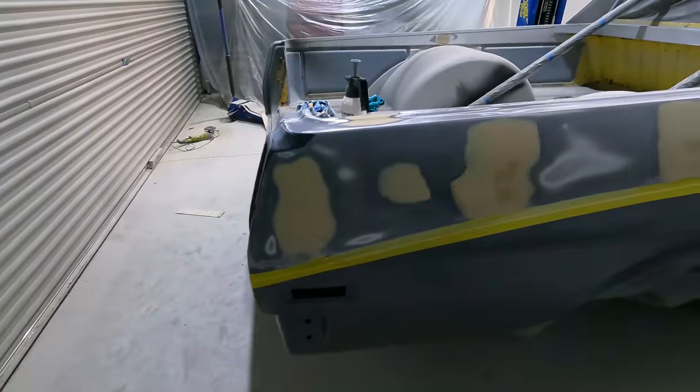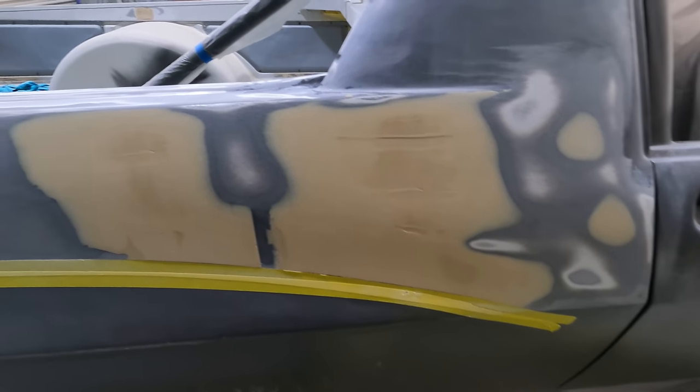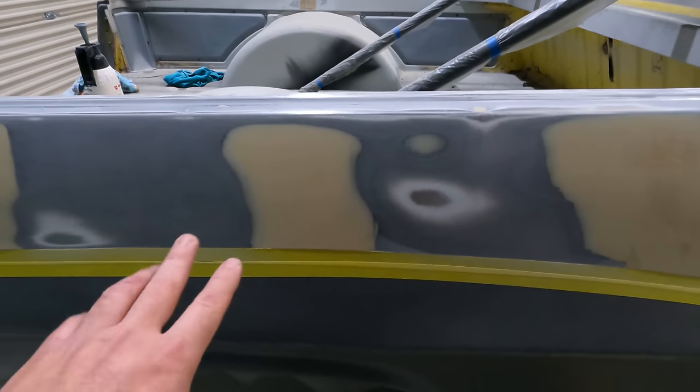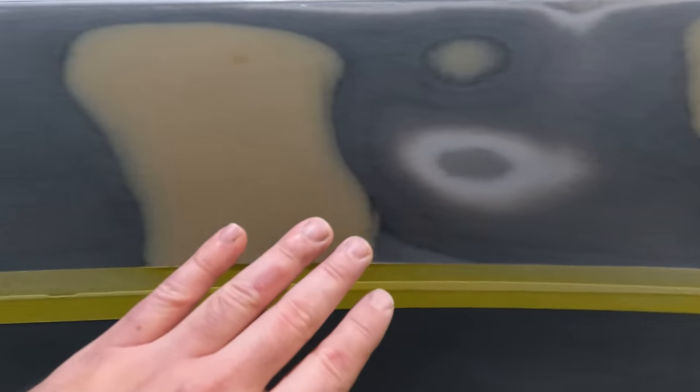So I just sanded that bog fill, and I'm going to add some more bog fill in here. You can kind of tell by looking at this roughly where the low spots are. For example, see this section here, how you can see that curve? Obviously that's a high area. But you see this spot down here that hasn't sanded and how the edge is still rough here. So it's going to need filler from about here to here. Fill that in, and then all that will cover.